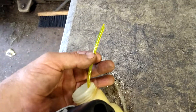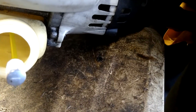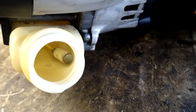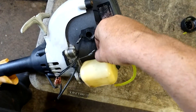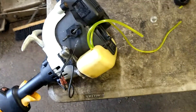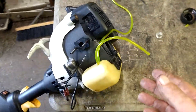Push this all the way in and basically work it all the way till it's outside of the fuel cap. Cut the tip off of it, stab the fuel filter into it, then pull the line back in until the filter is inside and sitting on the bottom, somewhere in the middle. Then cut a point on the second fuel line and shove it in about an inch or two — just getting it in the tank a bit is all.